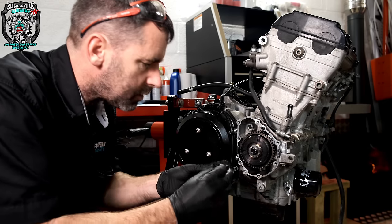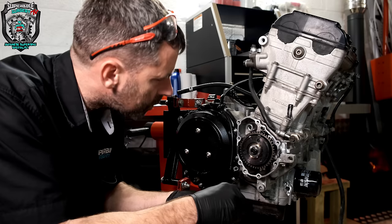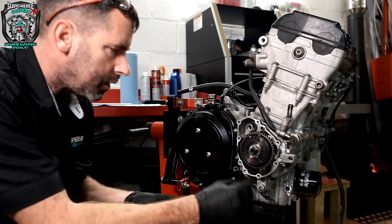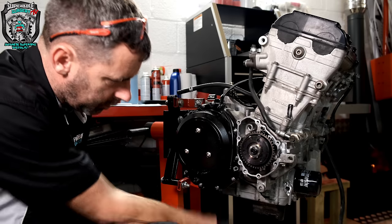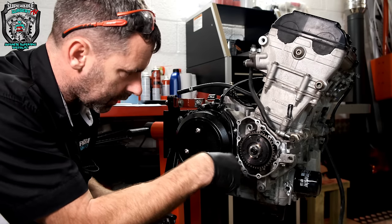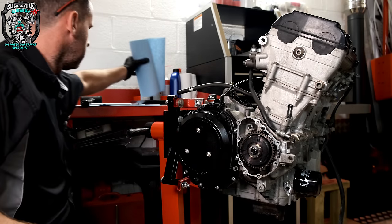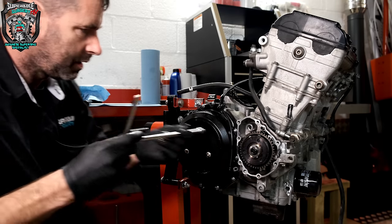There's a little sprung washer on the outside. What we're looking to do is split the crankcase along this line here — you can see where the castings join. You've got to pay attention to what is connected to the upper part of the crankcase and what's connected to the lower, because the lower crankcase is going to come off. Sometimes the cam chain tensioner blade is bolted into the bottom bit of the crankcase. Clutch cover next.